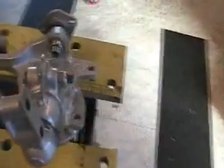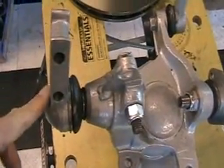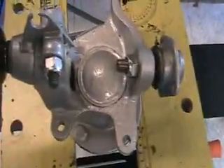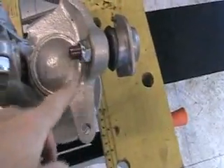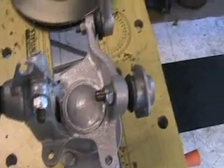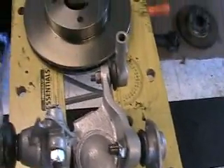The chassis has been painted as well and is ready to accept all the new components. There's the shock absorber ready to go on. I've got a new disc there and there's the upright. I decided to fit all the parts to it. I've put a new top ball joint in and a new bottom ball joint and a new track rod end. I've done that on the bench because it's much easier to get a torque wrench and torque these bolts up off the car rather than on the car. They're all brand new, ready for refitting.